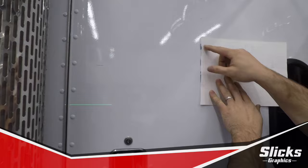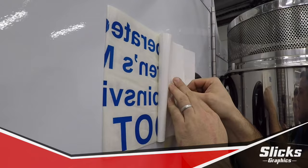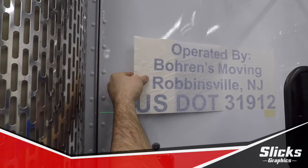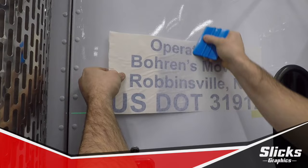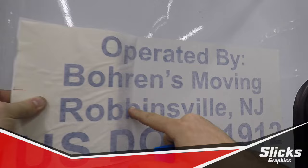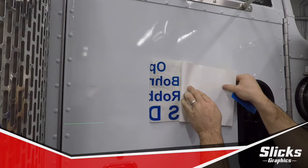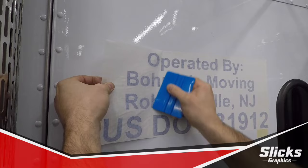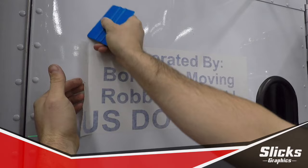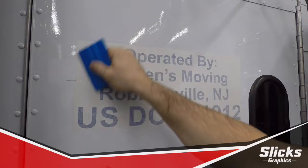Come back and carefully peel this film. You can remove it completely, or you can break it down into smaller sections, which I'll do so that those who are concerned can take this down and be more accurate with the install, and less likely to have a problem. Get to where you've got about an inch of non-installed film left before the release point, then simply continue to release the rest of the liner paper. I'm going very slowly so you can see that the squeegee strokes are roughly 60-degree angles — you can go down to about 45 degrees. Right on the money with the line, no walking issues.